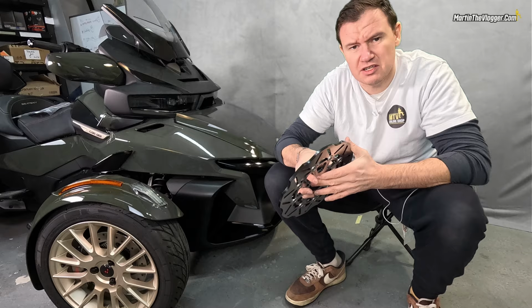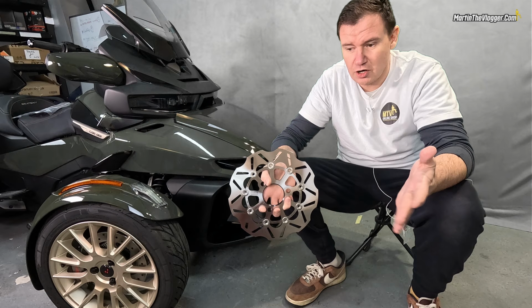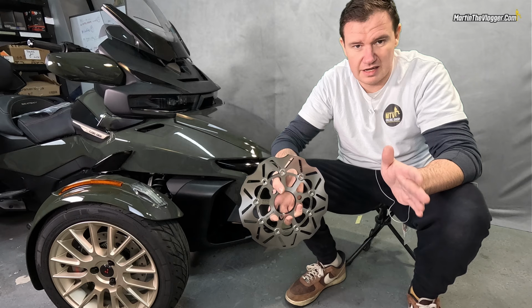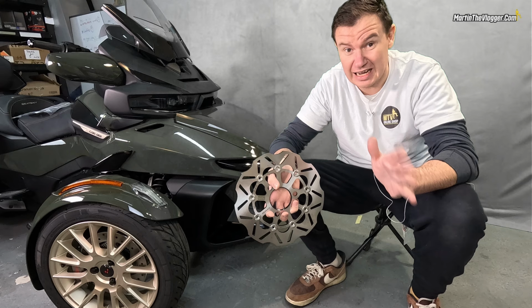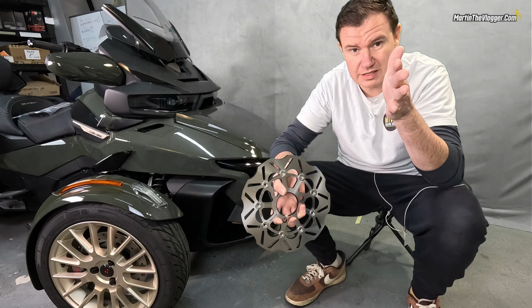I should be telling you, go and buy it. You don't need it. You will have stock rotors that you might destroy if you are a more aggressive rider. You have simply RT, which is super heavy. And you go from the shop, you go for a ride, and many people hit it hard, test it, and you simply put too much heat into the rotors, and it doesn't need a lot, and they will twist because they have nowhere to expand. The rotors are underperformed. So they will twist, and once they twist more and more, they will create vibrations.